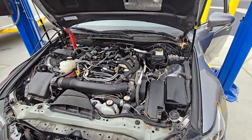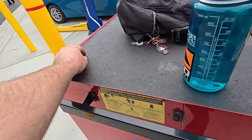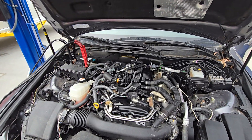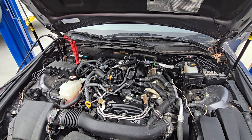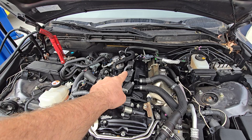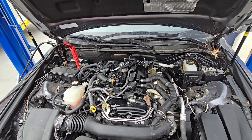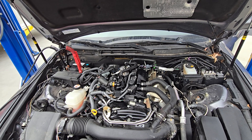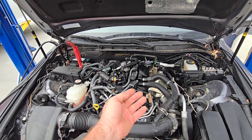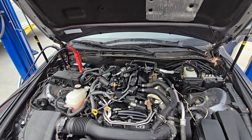Well, this car has a misfire — we have a misfire on cylinder number two. We could do a spark check, test for spark, and we did, and it has spark on all four, but it's got a dead hole. So if we were to do a power balance and disconnect one coil at a time — this coil would drop, this coil would drop, this coil would drop. We know cylinder two is not working. The relative compression test is just a fast way to tell if it's an actual internal engine malfunction causing low compression. The fact that cylinder number two, when it was on the compression stroke, went fast — it's because it's not making any compression.